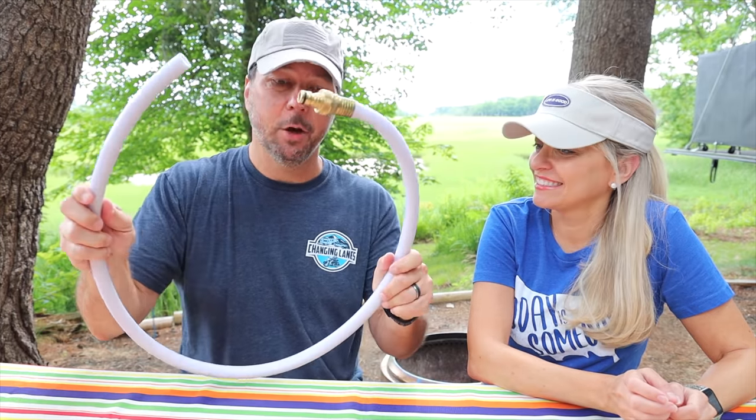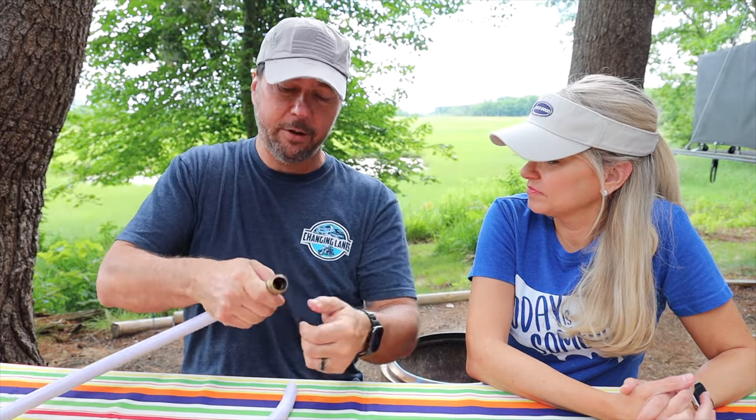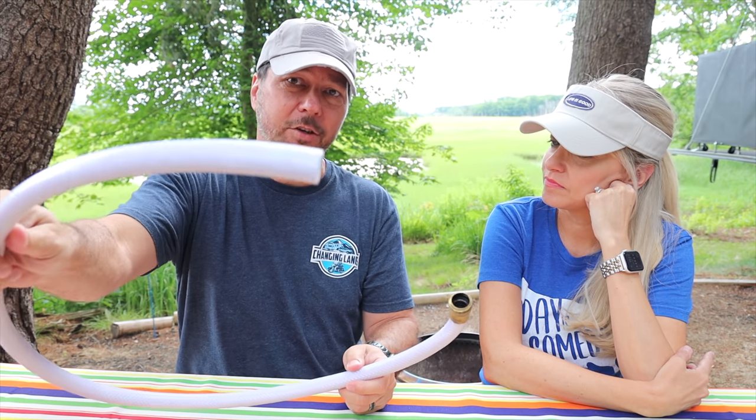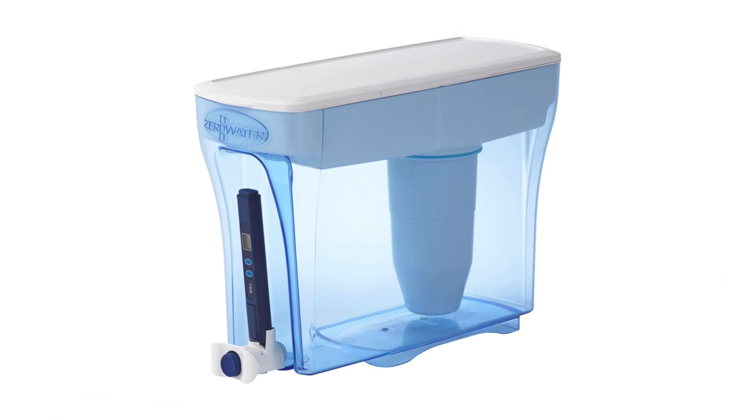You're going to need a bucket — probably a five-gallon bucket so you're not constantly refilling a one-gallon bucket. You're going to need a siphon hose. Usually your fill system has a standard female connector on it, so you connect the male end in. We had an old potable water hose that we used as a backup; I just cut off one end to go in the bucket. You can buy these at Home Depot. Also, it's important to have several jugs of water because if you're stationary like we are today, you won't have running water for washing hands, drinking, dishes, or cooking. You can still use your toilets though.